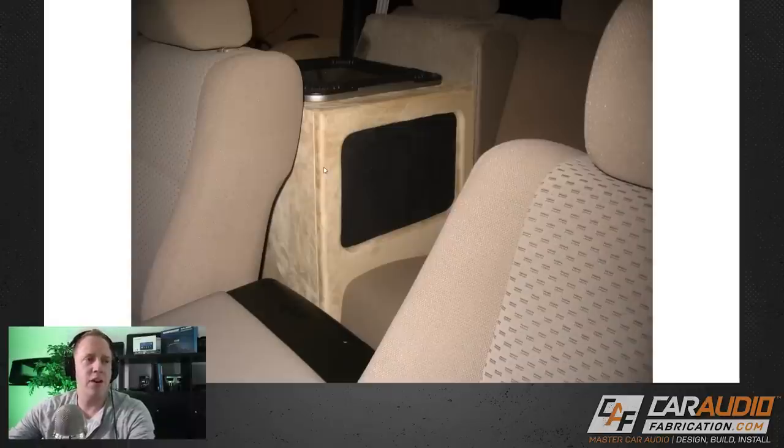Another construction issue is this line right here. What I did is I wrapped this piece of the enclosure separately from the rest, so this is actually two different layers of wood. What I'd do differently now is make this part permanently attached, wrap the upholstery materials around it, and use this insert here as a transition gap. Rather than having only one color of insert, I'd put something on the inside to hide the seam with a chamfer around the inside edge to transition between materials, eliminating this random side piece.